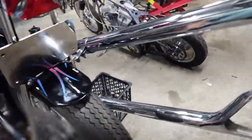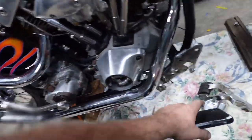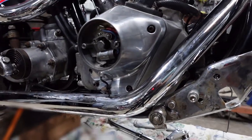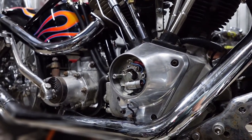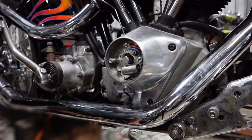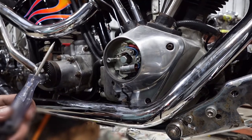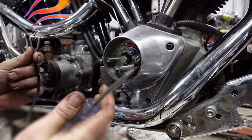So you come back over to your points. Once your motor's in the right spot, then you set your points. I'm gonna put you in your little cradle here, so I can work on this. You're gonna need a test light. You've probably seen me using test lights quite a bit on these. That's all these things need to do a lot of jobs.